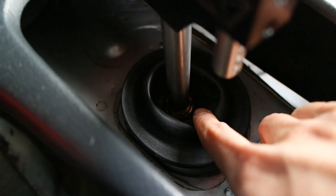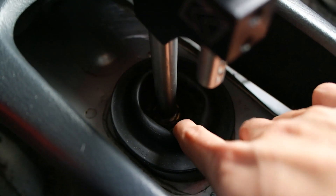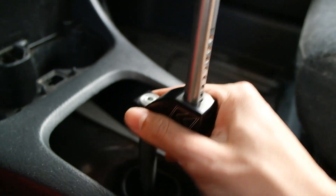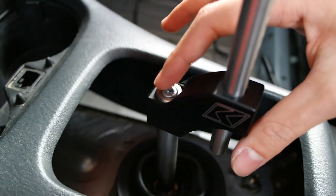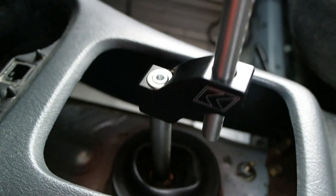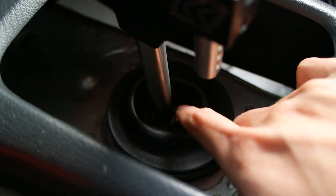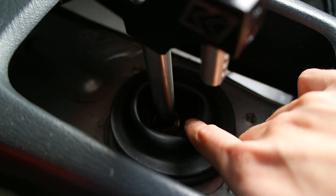You can see the gold ball down there — that's what you use to adjust the throw. That's the main feature of the second version. The shift is really solid. With the first version, the hex key normally gets loose while you're driving, but I had no issues with this at all. The benefit of the K2 shifter is you can adjust the throw, but the only downside is you always have to drop the shifter to adjust it.